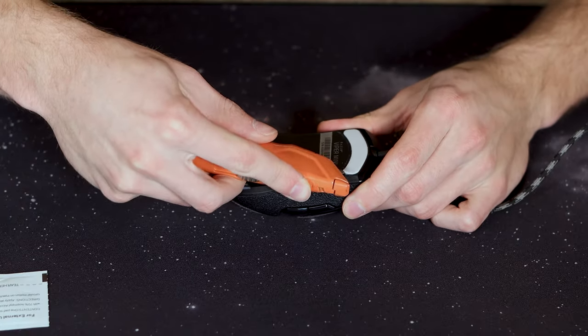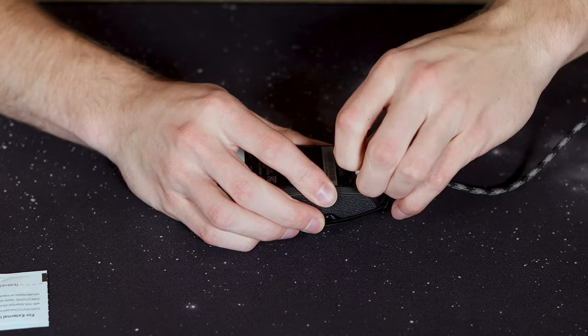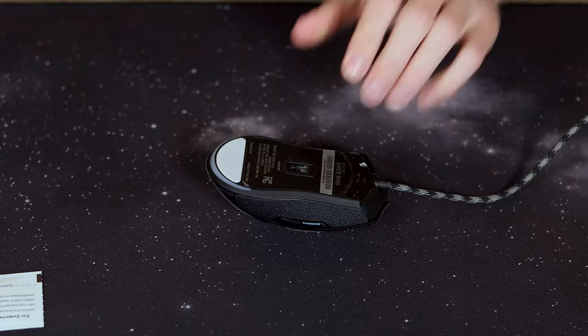The last thing we're gonna be changing today is the glides or skates on the bottom of the mouse. I'm interested to see how much difference I'll even be able to tell, because the Razer Viper Mini already has pretty solid stock glides with 100% PTFE feet on it, which is really nice to see especially for the price point. The skates I'm using are the Tiger Arc 2, which can also be found on Lethal Gaming Gear's website. Taking the feet off is as simple as prying them up — I used just a little edge of a razor blade to get the edge up and then grabbed it with my hand.